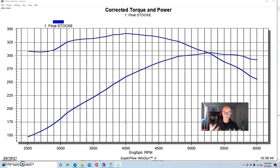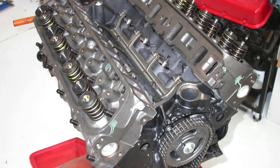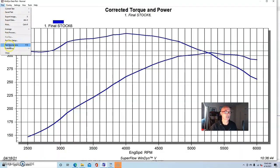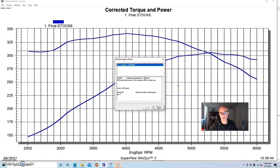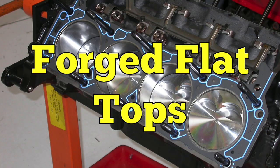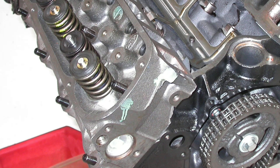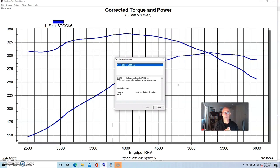What we have is a basically stock five-liter motor — a 302. This was run back when I did a cylinder head comparison, so we have a rebuilt 302, although this works equally well for any junkyard motor. We're doing it on a 302 but you can also do it on a 351. What we did was run this thing first with the stock E7TE heads — this was from a 1990 Mustang engine.